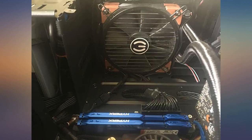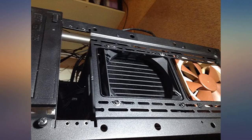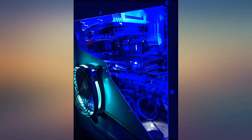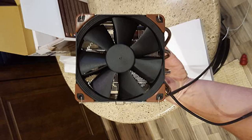But I wanted more airflow for a better overclock on my FX 8350 CPU, so I bought these and replaced the other Noctua fans. I can hear these, but only because it really is a 3000 RPM fan. You can't hear the 1500 RPMs, but I want the extra security of higher fan speed. I can set these up in CorsairLink to run at 1500 to 2000 RPMs and my system will bump it up a bit if I start to heat up.